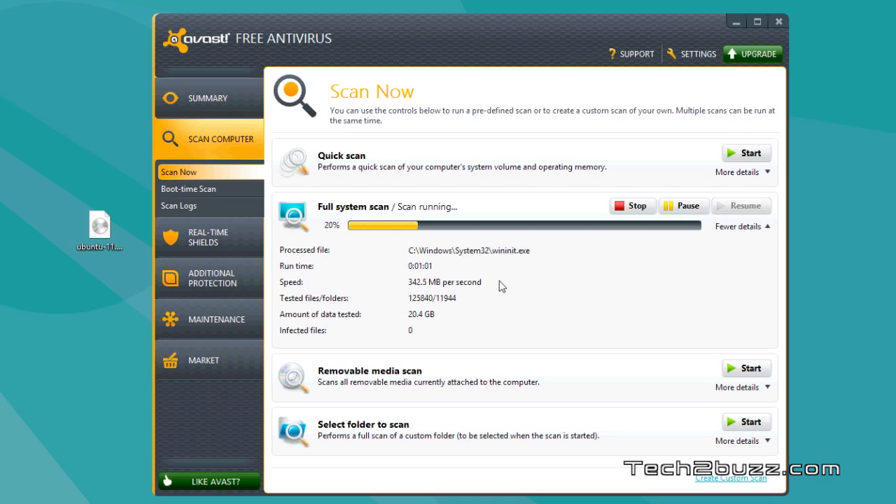Overall, this is a nice drive — I would say a good mid-range SSD. Do note that to get the best performance out of this SSD, make sure your motherboard supports the SATA 3 controller; otherwise your speed will be limited not because of the SSD itself, but because of the SATA 2 controller on your motherboard.